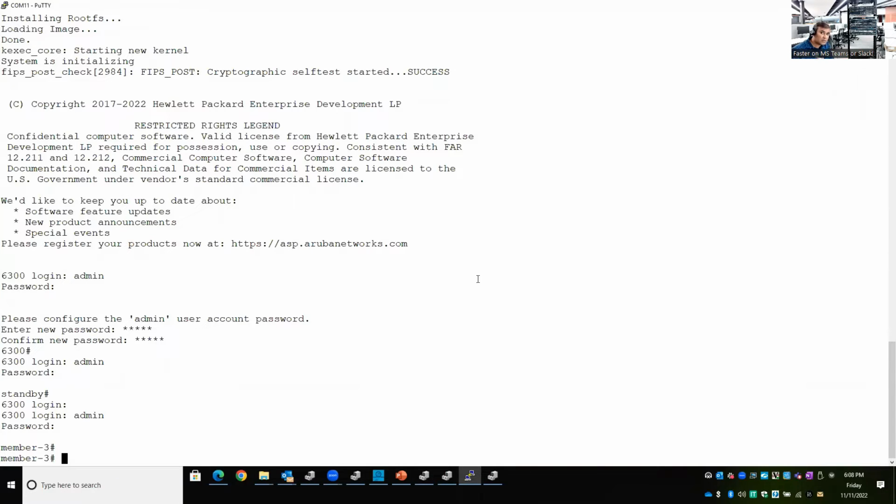Let's consider after some time I get a factory default switch. I order another new switch. I want to grow the stack to 4 members. It's very, very simple to add to the existing stack. Get the factory default switch, connect it below, and take the ring cable to the last 50 gig port on that new switch, and connect the same way you have connected the upper 50 gig DAC. Automatically it will join the stack without any disturbance on the existing members.